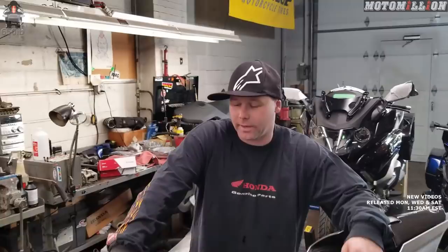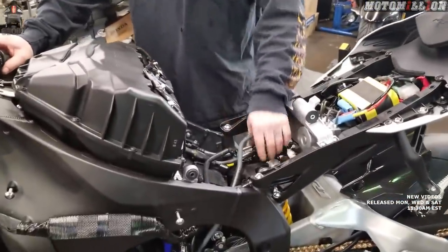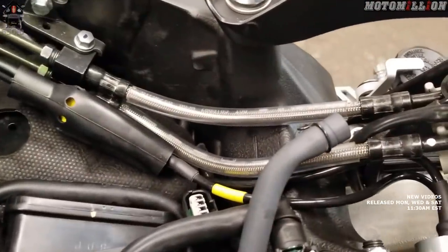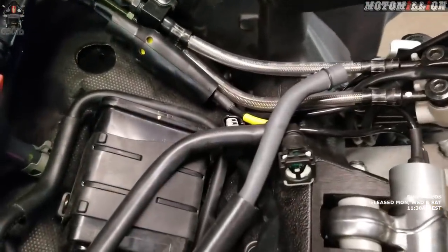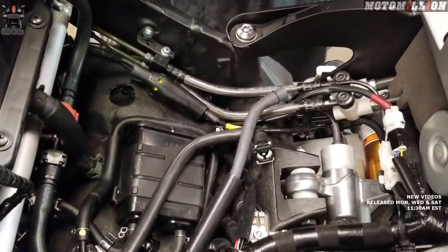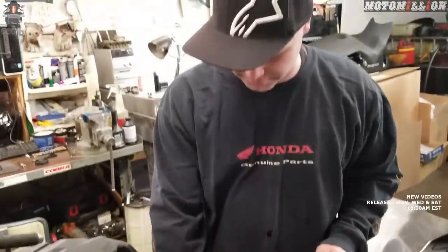Zach, I can't believe we're already on bike number five. We are going to get the front master cylinder installed and the rest of our carbon fiber brake lines. We'll start back here and change out these two lines that come in the kit — might as well do it for the best feel. These ones are all pre-formed at the factory so we don't have to worry about it. Looks like one's a little longer than the other, and we've got to deal with another block and some more of these nice steel fittings.